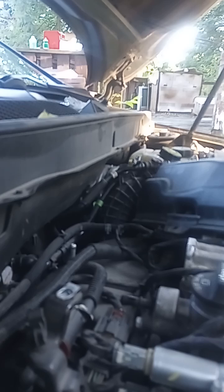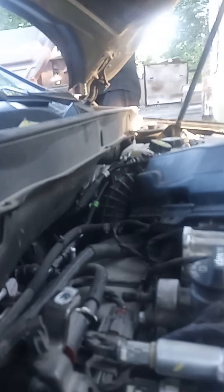All right. Dorman part comes with no instructions at all on how to do this. All it comes with is the bolts and a recommendation to get an oil change. I might be able to find that little tag. Yeah, right here. When you get the Dorman part, this is what it comes with. That's it. No type of instructions that mentions these little plastic pieces on the bolt. GM put those plastic pieces on them bolts, so those are on there for a reason. I'm going to have to reuse the ones that GM installed at the factory.